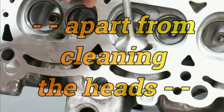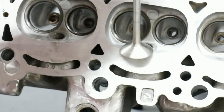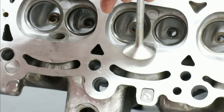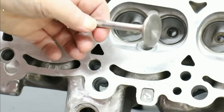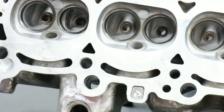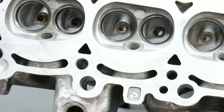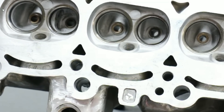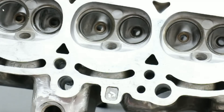The other thing we need to do is to polish the valves. The front face is not important at this stage, but the back face is. This is the exhaust valve ready to go in. Last, we need to lubricate the port. I use a mixture of oil and WD-40 — about WD-40 with 10% engine oil in it. I have heard that PAM, the non-stick cooking spray, works very well, so you may want to try that.